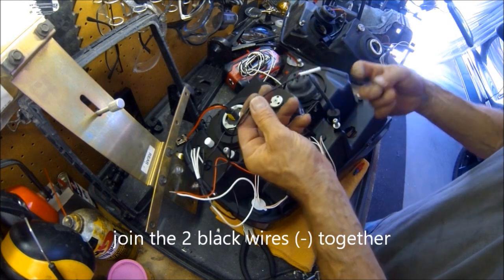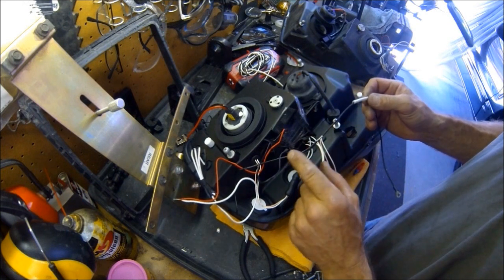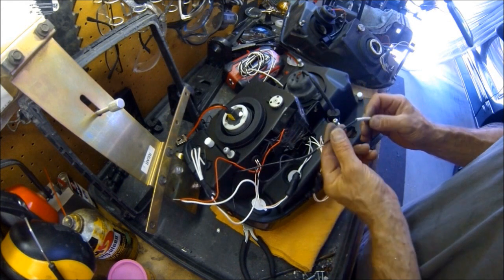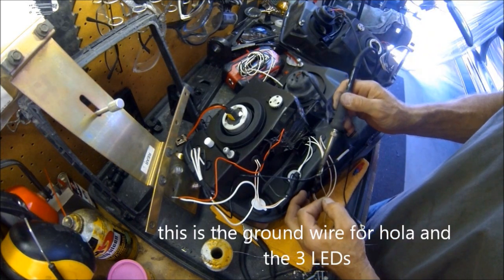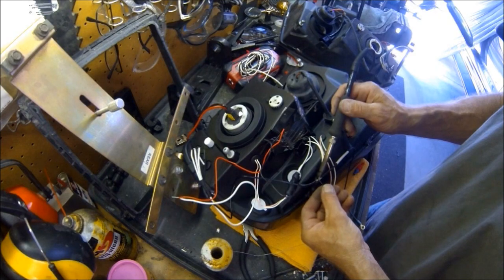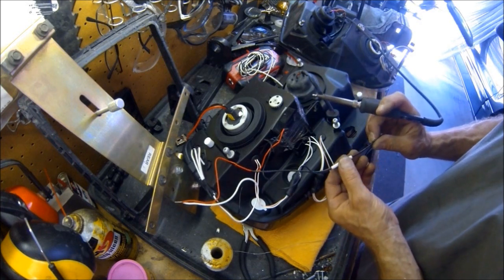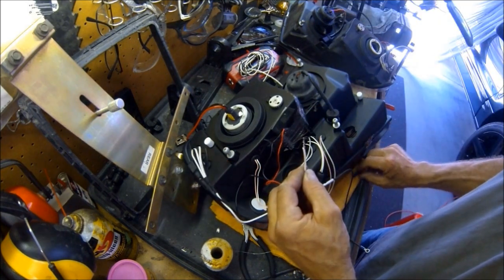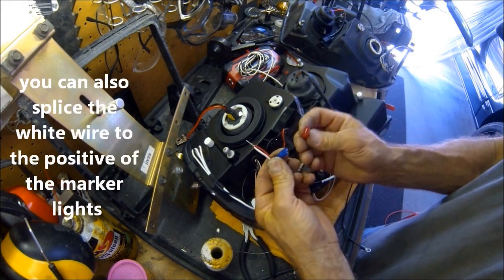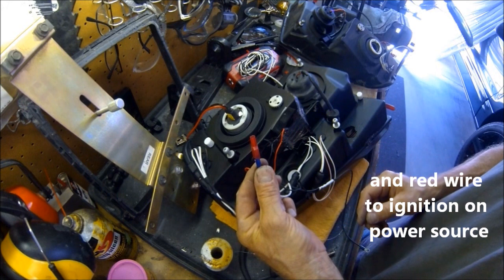On the negative side, I've just added a chunk of wire around 10 inches long, and got the two negatives from the halos and the LEDs tied to here. I'm going to solder this on and then slide a piece of heat shrink over it. Then on the positive side, I'm going to use a couple of these spade connectors — I'll put one on one end and one on the other so I can easily disconnect this if I want.